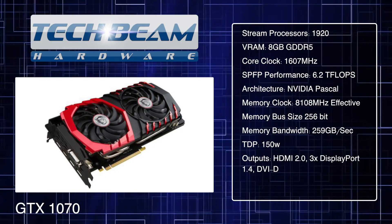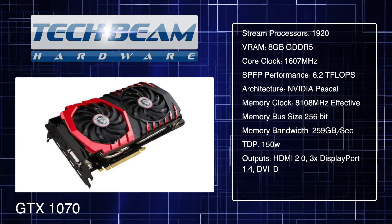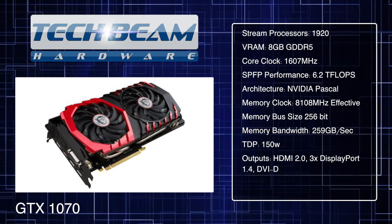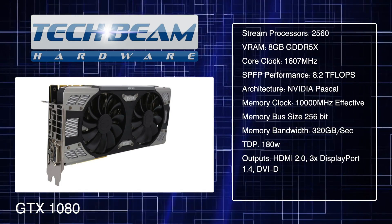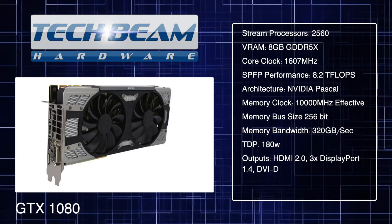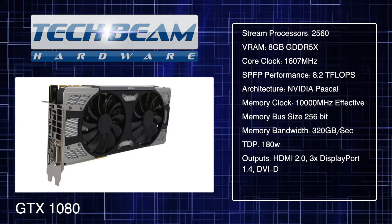If your budget is high and desire for performance strong, consider a GTX 1070 or GTX 1080. While I definitely wouldn't recommend installing one of these in an OEM system, either of Nvidia's top-end Pascal cards can deliver amazing performance even at 4K resolution. A GTX 1070 equipped system can be built for around $1,200 and a GTX 1080 system for around $1,500, or about $200 more if you decide to go pre-built. These cards use the latest display connector standards, HDMI 2.0 and DisplayPort 1.4, so you should have no trouble connecting high-end monitors or VR headsets. EVGA and MSI's aftermarket 1070 and 1080 models are top picks, at around $400 for a 1070 and $650 for a 1080.